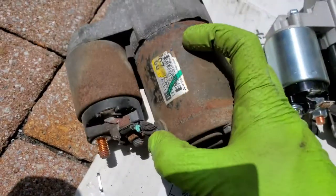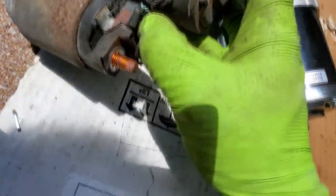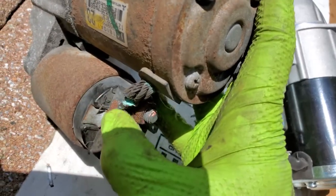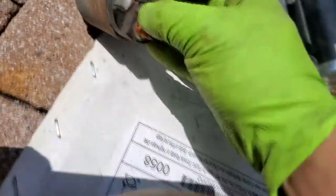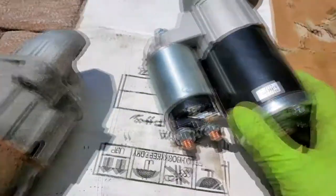Make sure you check this ground wire, but it's unfortunate — you might need to solder a new wire to bridge the two ends. It's so corroded right here. So just make sure this connection is okay on your car before changing the starter.